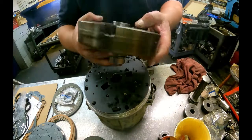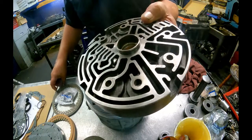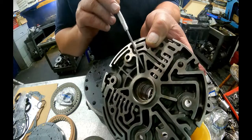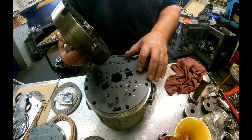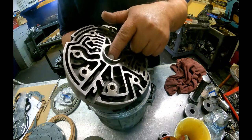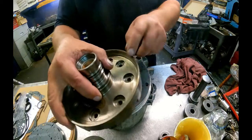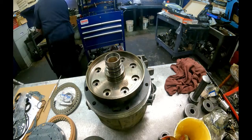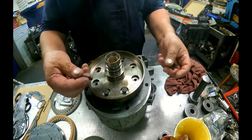I'm thinking of the pump. So when you're putting the Transgo bushing in, there's a hole right down in here. You're going to need a press to press this bushing in and out. There's a little small hole that you have to line up with this hole, and make sure you put the bushing in the proper way and that you get that hole lined up. The bushing is pretty much even with the hole right here and up here. Then we've got two short holes that go together down here. Half-inch head bolts go down here.